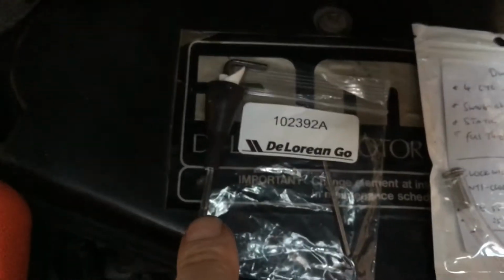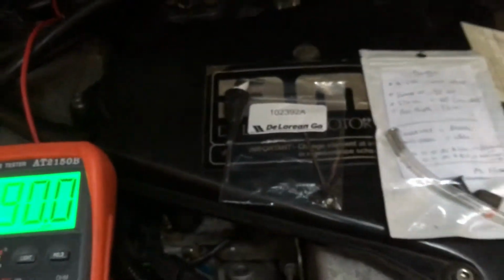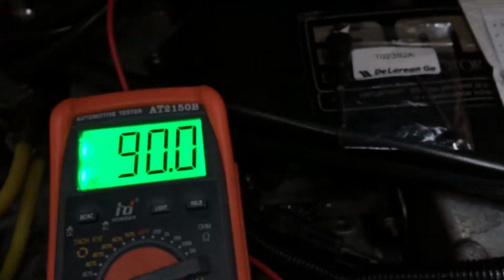Because what I was finding is when you remove the bung, the engine will basically suck in loads of air and then it'll stall. So what I was having to do was turn off the ignition and then pull the bung out, obviously carefully, as it's in really tight, adjust it with the Allen key to richen it or lean it out, put the bung back in properly, and then start the engine up, then let it warm up a bit further again until it starts to swing on the meter. It's a load of hassle, basically. You just can't really fine tune it.